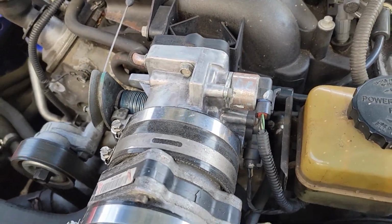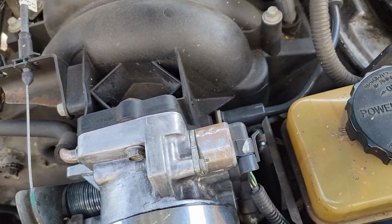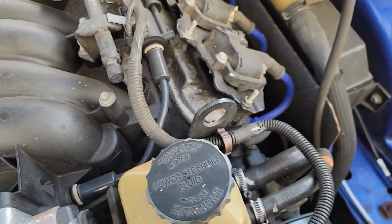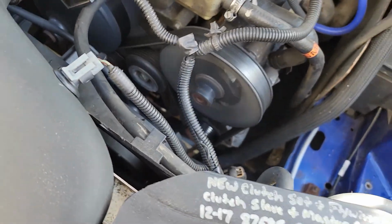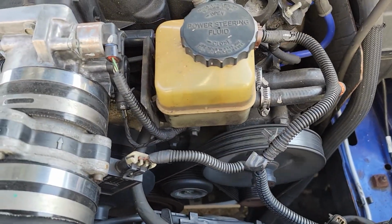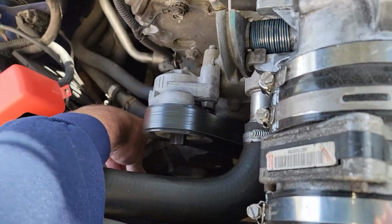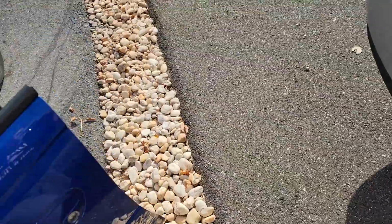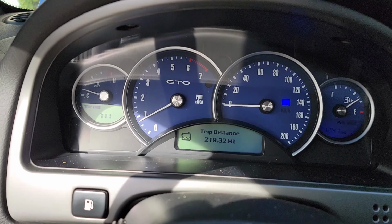And the temperature, it actually is starting to climb. So it has, I think the thermostat's opened up. I reach down, this still feels cold, but I think the thermostat's opened up. I don't know, it still feels cold, so who knows, it just could be getting that cold water from the radiator. Radiator hasn't heated completely up yet, but the gauge has climbed